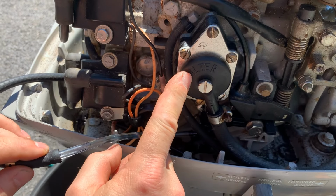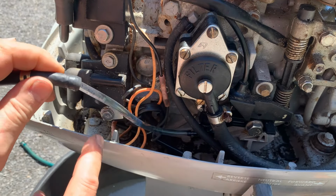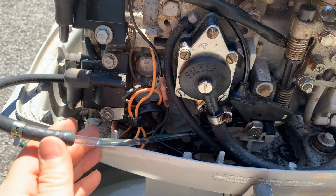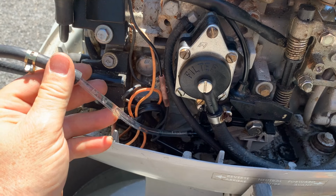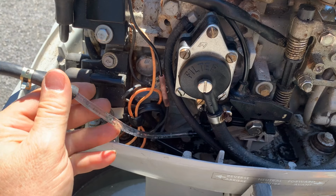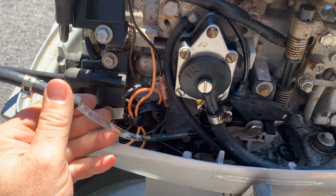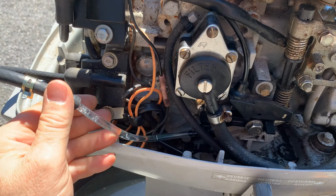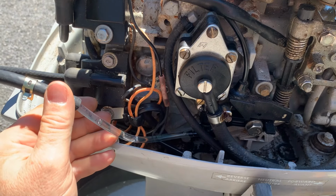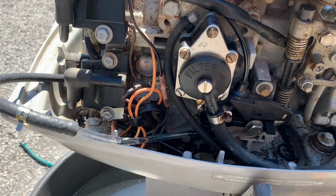The other option could be that air is being introduced to the fuel line and we're not getting pure fuel. And I might be correct with that. I'm gonna prime it. Watch this carefully. There is definitely air in that line. So what I'm gonna do here, I'm going to fill up the bowl again and let it run. And for the first time, we're gonna be able to watch. Yeah, it's filling up the bowl and the pressure is getting harder, there we go. Okay, so the bowl is full, meaning the needle inside the carburetor has closed off fuel flow. And we have air in the line here. I think I might've found the problem.